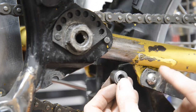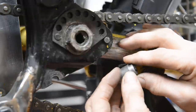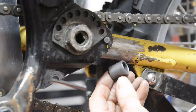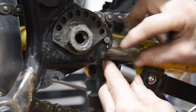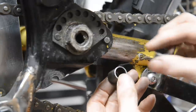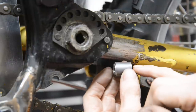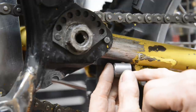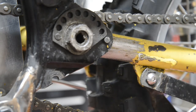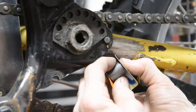Now, just as I was talking about, we don't just want the leg to be like that. It's got to have a nice wide contact area. So the leg is going to be 3/4 inch chromoly. That is just fractionally more than 3/4, so that when that's on, we can get a nice joint round it. And that runs on this, which, I don't know whether it shows up, is actually 7/8, and this is fractionally less. So we've got about 15 thou showing at each end so that we can grip it tightly when we put the bolt through, and that will still turn.